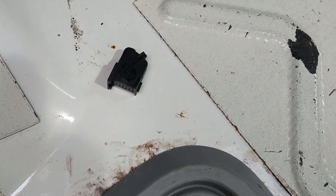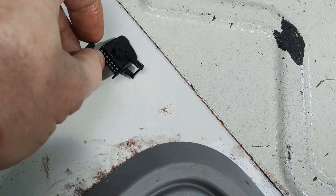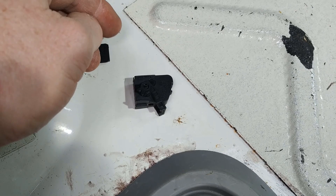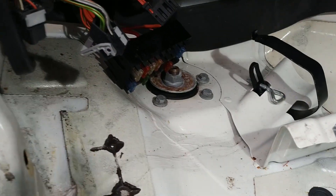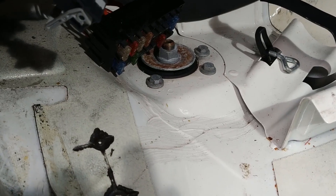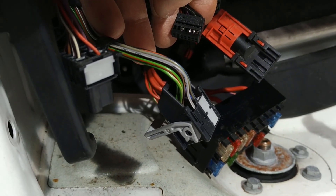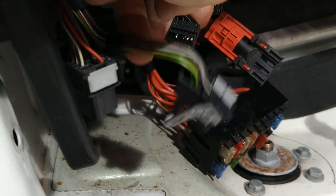This connector normally sits in a shroud and pushes in through the back. That part there slides off the back — there are a couple of little indents in the plastic to retain it, but once that's slid off the whole connector comes out the back. I want to actually disconnect the pin from the connector, which is easy enough to do once it's taken apart. Disconnect the pin, splice a wire into the connection, put a bit of heat shrink on. If I didn't disconnect the pin I'd have to wrap it in tape, and I don't like wrapping stuff up in tape.